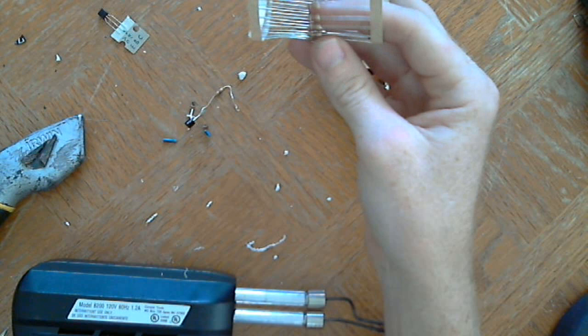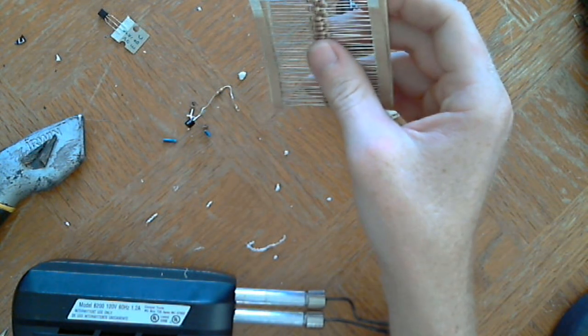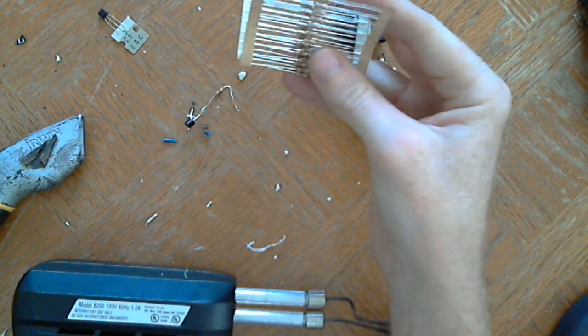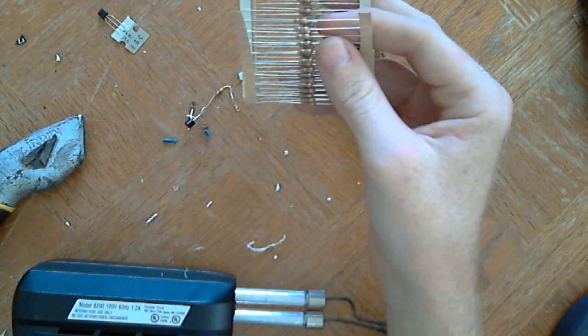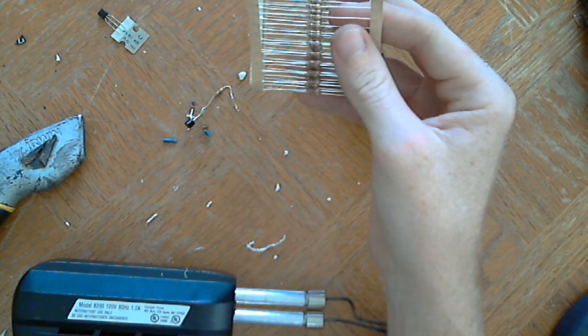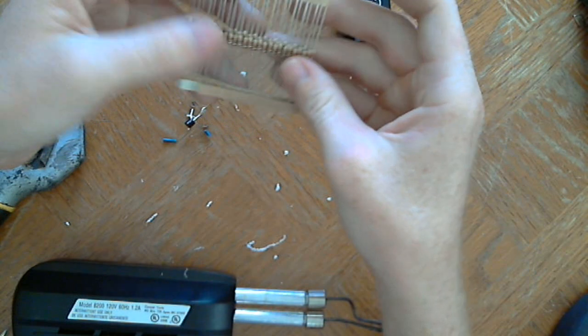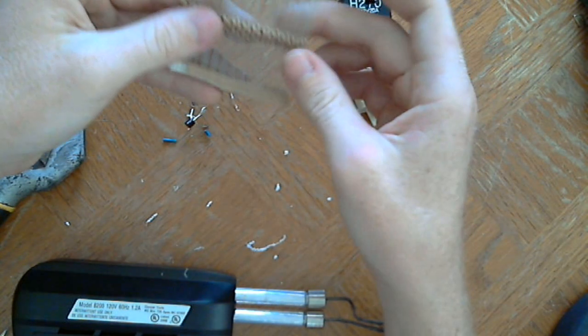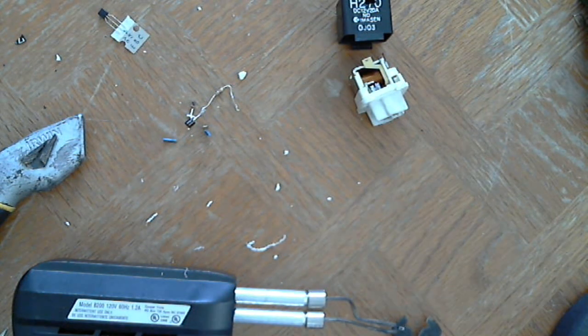So you would use the potentiometer instead of a resistor if you wanted to fine tune your RPM gauge. If you can't use a 1,000 ohm resistor, and you don't know the exact resistance level that you need, you can use the potentiometer to find out. Those are also pretty cheap. You would just have to find one that's rated within the correct range, say 500 to 1,500 ohms, or something that would provide you the right type of signal.